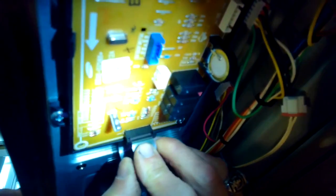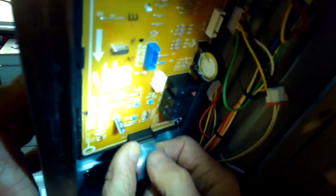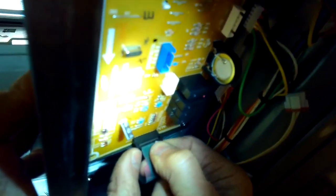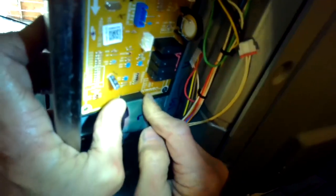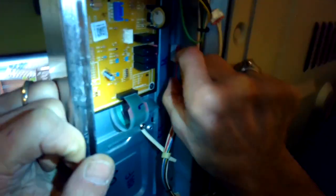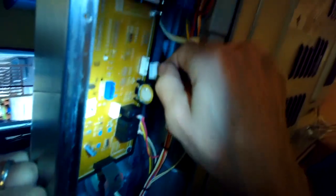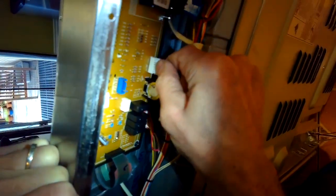We're going to put this ribbon cable back in — first we push it in, then pull up on the little door in the front of it, lift up with your index finger and thumb and push in. Just take your time here, this is a little tricky — you don't want to break this thing, it's a little bit fragile. Get it into position, wiggle, push, and then push down on the little door to lock it in. Give it a little tug to make sure it's all the way in. This is how the touch pad will talk to the control, so you've got to make sure it's all the way in.